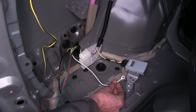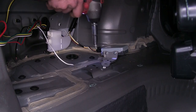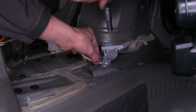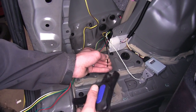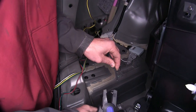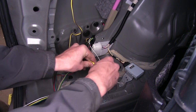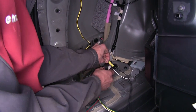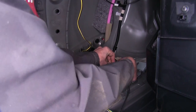Our white wire is our ground wire. We can attach it right here to this existing bolt on this bracket — remove this bolt with a 10-millimeter socket, place the bolt through our ground wire, and reattach it. That'll give us a nice solid ground connection. This black wire is our power wire for our module. We'll strip off a little more insulation and attach a yellow butt connector to it. Now we'll take an end of the black wire that comes off our kit, strip off some insulation, insert it into the other end of the butt connector, and crimp it down. We'll wrap our connection up with some electrical tape to help keep any debris or moisture out that could potentially cause corrosion or a short. We'll do the same for any other connection made with a butt connector.